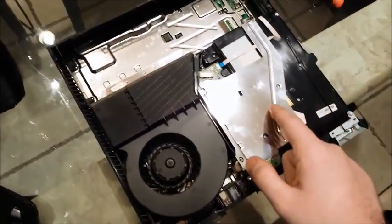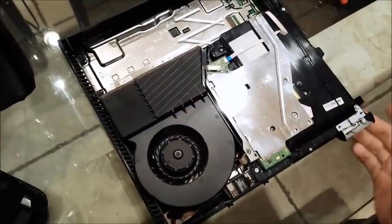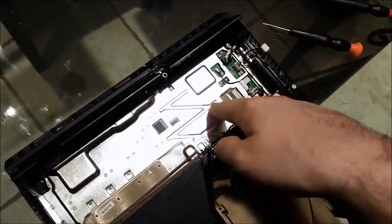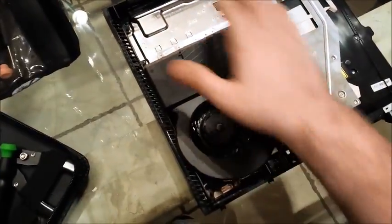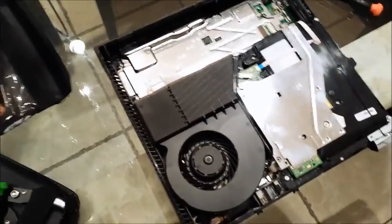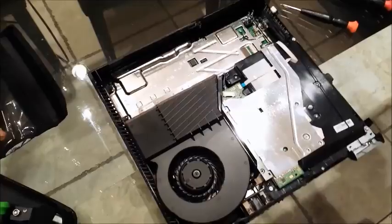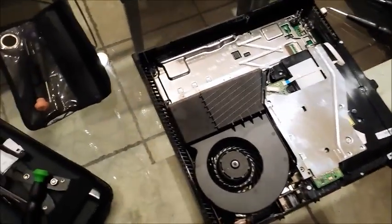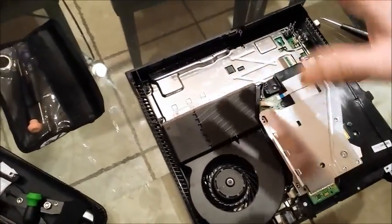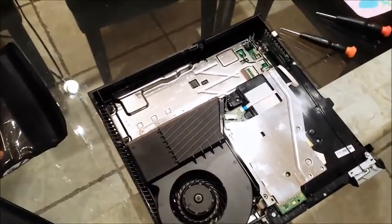Now what we're going to do is remove this metal cover, get the Blu-ray out, turn it over, get the other side completely off, and then get inside this metal case which is holding the motherboard — that's where the chip is. We do not have to remove the fan. The fan is part of the cooling housing. All we're going to do is remove the Blu-ray, turn it over, remove the covers, and then open the cover to the board and we'll get right to the chips with the thermal paste.